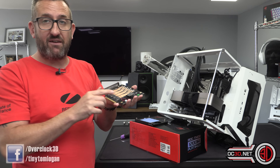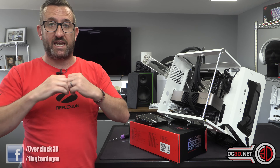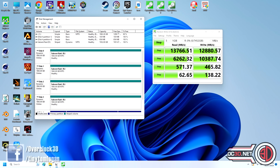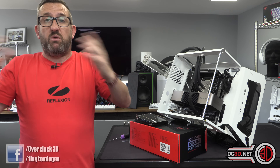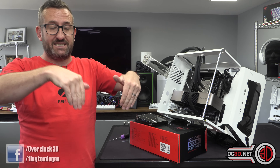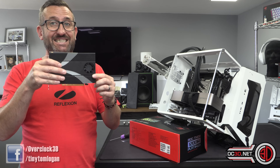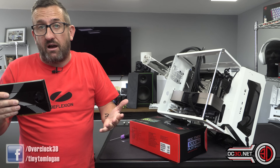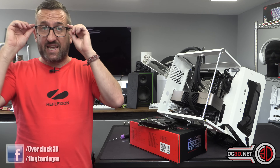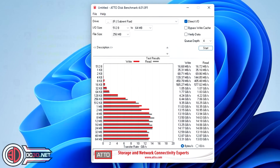For performance I did a basic software-striped RAID array. You can choose RAID 6, RAID 5, mirroring, or JBOD, or just leave the drives individually accessible in the OS. The card can also be used as a system boot drive — you could put Windows on one drive and RAID the other three. I saw 14 gigabytes per second with the Rocket 4 Plus drives I had here.